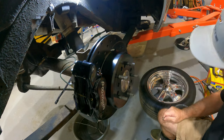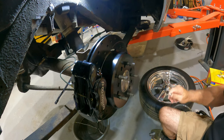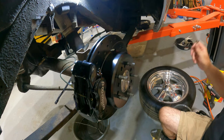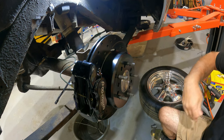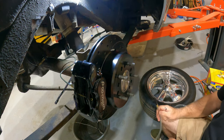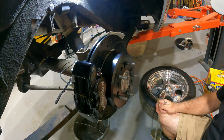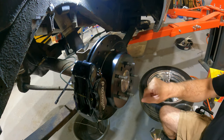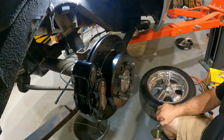All of the fluid through the lines — they're all bled and they're not leaking anymore. We installed so many new lines on this car, so many fittings and everything. We just kind of had to watch how the fluid was running and how it was sitting in the lines. It just takes a little while to track them all down and tighten everything up and make sure it's not leaking anymore. Once it stops leaking, then you can really start bleeding it out. I like this brake bleed thing — this is a game changer for those of you that work in a shop by yourself, because you can bleed brakes and clutches with this thing a thousand times easier.